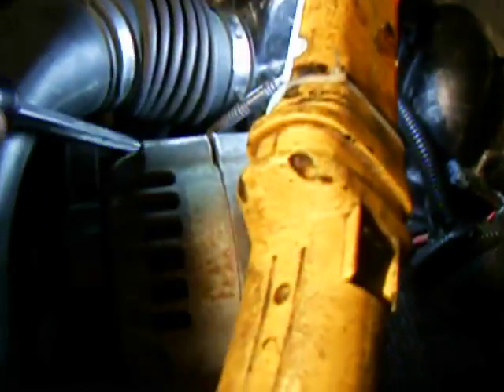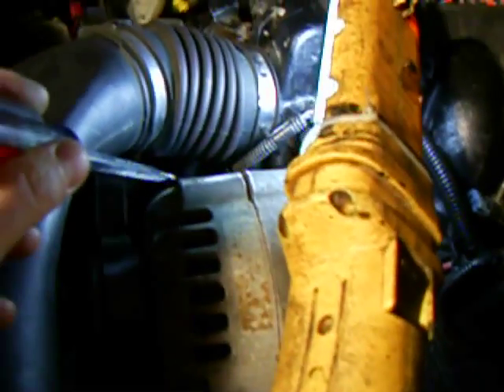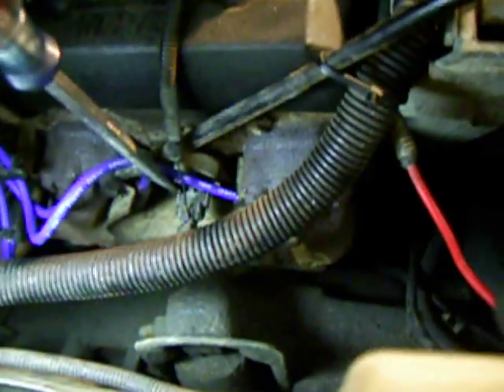There's one more in here — the intake air temperature sensor, right there in the bottom of this rubber boot. If you take this rubber boot off, make sure you don't tear that wire harness off. We also covered the knock sensors. There are two knock sensors, one on either side of the vehicle. I showed you the one on the driver's side. On the passenger side it's in plain view — much easier to see. It's right there.